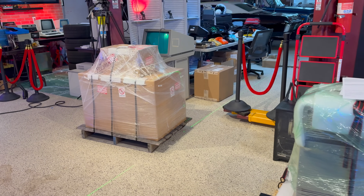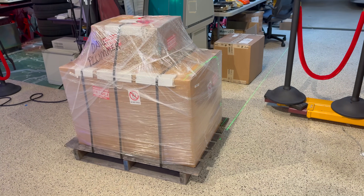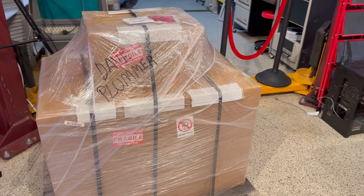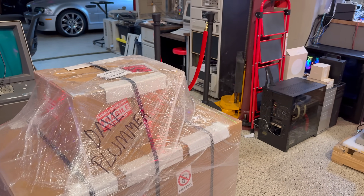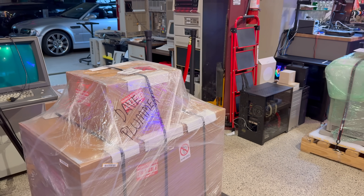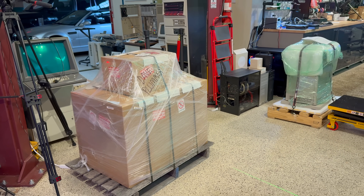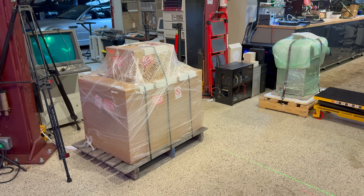You can feel it through the floor when it seeks hard. Now this project had been haunting the back of my bench for months. I've been running the 1173 off of a Unibone, and when I wanted to be lazy, a later year full-height DEC RA73. I even installed a SCSI controller and got the PDP booting from both real and emulated SCSI drives, including a Jaz disk. All fine, all nice and quiet, but none of them were satisfying. What I really wanted was period-correct storage with its own beautiful set of limitations, rituals, and noises.